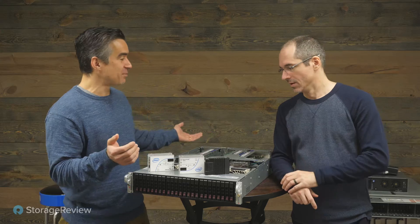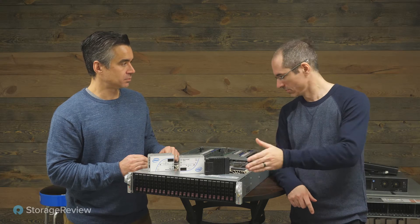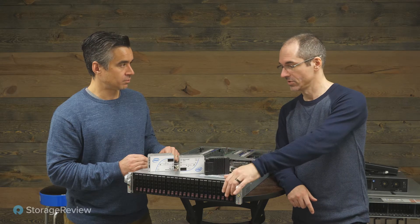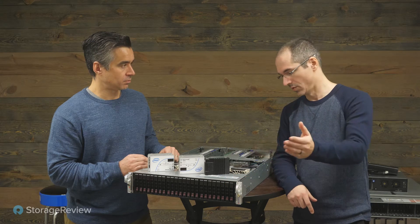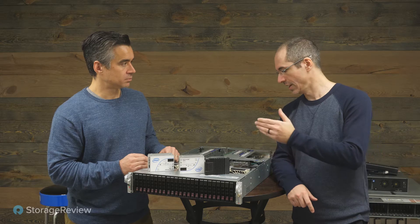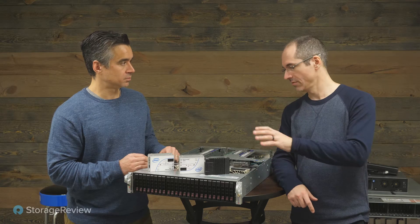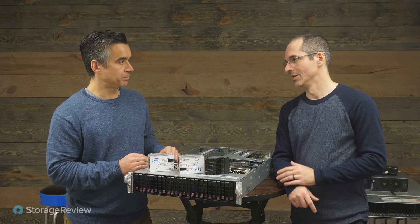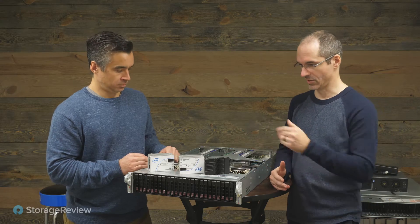We're missing hard drives, but we could slam them on a JBOD off the back if we wanted. You could have everything from smaller and faster all the way up the stack. You could potentially have hundreds of terabytes of NAND sitting in the front that you can access relatively quickly without worrying about switches, getting maximum bus-saturating bandwidth for those drives into the persistent memory. Even though the server has four terabytes of PM, which is impressive, one of those QLC drives is 30 terabytes — so there's clearly a difference in the ability to store way more data on a device hanging off a different bus.